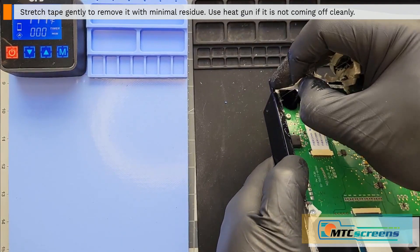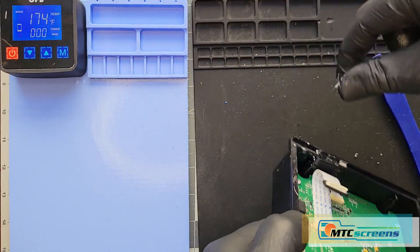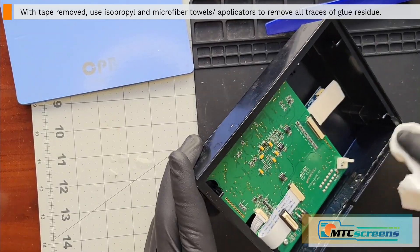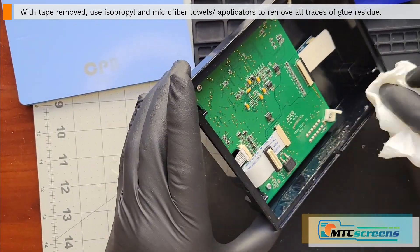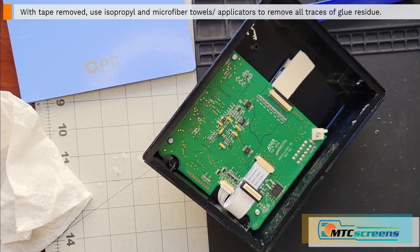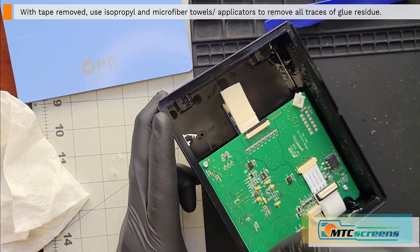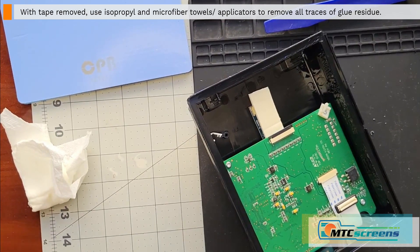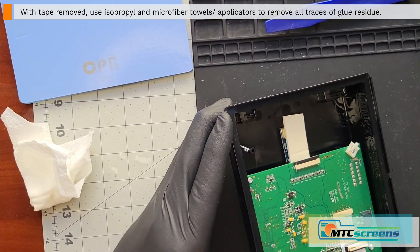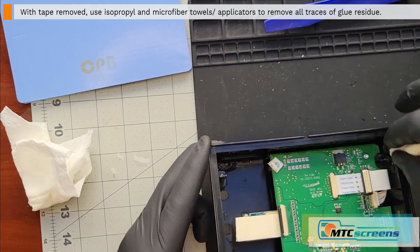In this example you can see there was a little bit of glass breakage on the corner — if that happens, work around it and pull the glass pieces away carefully, as it's sharp glass. Now use isopropyl and microfiber or paper towels with 90% or higher isopropyl to remove the glue residue. The glue residue should really melt with the isopropyl — be very thorough and don't stop until all residue is removed. You need a clean surface with no dust and no remaining glue. Note that we only need to remove glue from the flat surface where the new panel will mount.